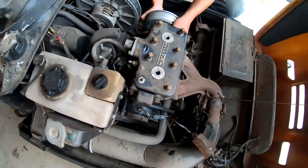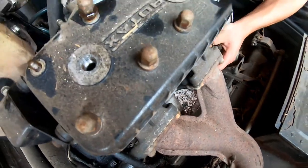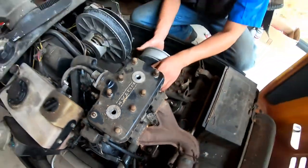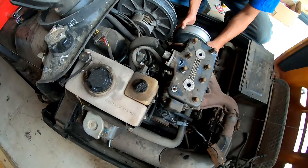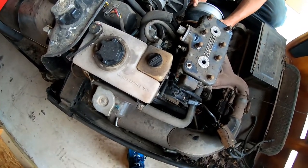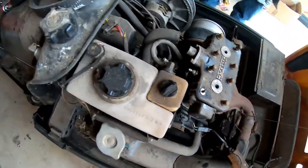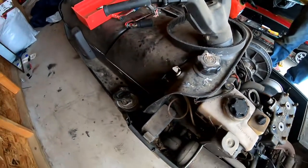And this here has a spot right here. It's at top dead center of one of them. It feels a little off kilter. We had a Phazer like this too that had a tight spot, and I think it's a crank bearing when that happens. So if we can get it running, we'll just run until she drops. For $40, guys, we just send these. I mean, it's sad because the cosmetics and everything are good.